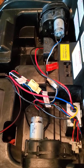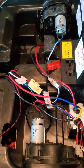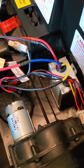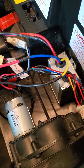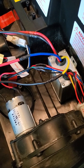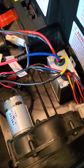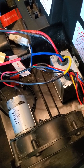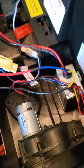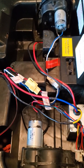If you have any questions, let me know. I do have a couple of wiring diagrams for the brake — one with a relay setup, which I'll probably do on the next build. I've heard that when these ESCs short out they tend to do so at wide-open throttle, so you could have a runaway vehicle. That relay helps by sending power back and essentially shorting the motors so you can stop. The next build I actually have a remote disconnect going in, which gives you the ability to just hit a button and stop power going to the motors. For the most part, fairly simple setup — it took me a bit just because I had to play around with the wires to figure out what they were.